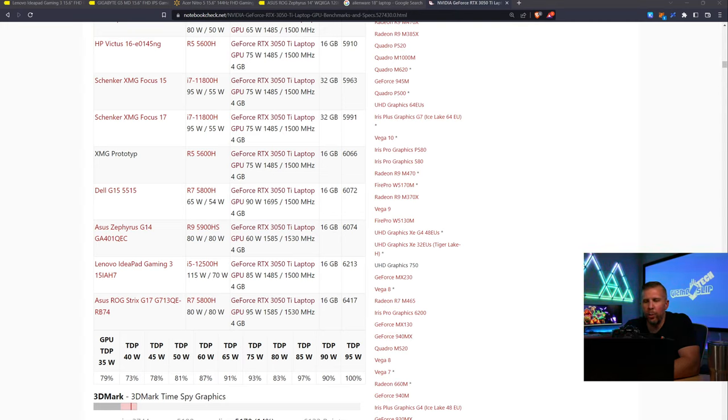All right, so that time we only got 3130. We must be throttling a bit, probably thermal throttling. Because we're thermal throttling, our clock speed and everything is going to be dropping down a bit. You can see our effective clock speed is, interestingly enough, not matching up to the direct clock. I'm not sure which one you're supposed to be looking at here. But we can see we're not hitting the full 4.2 gigahertz anymore, because we were at 4.25 when we first started. So we're getting some throttling on the CPU.